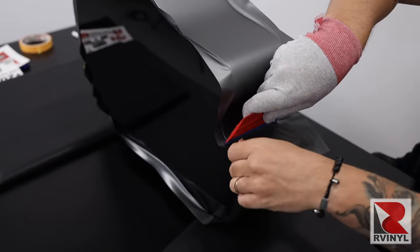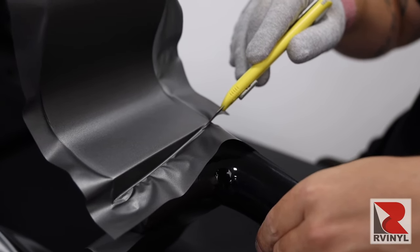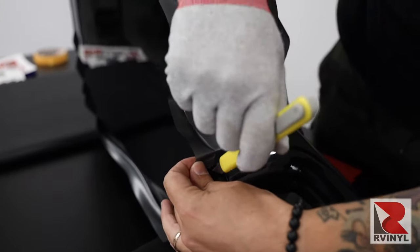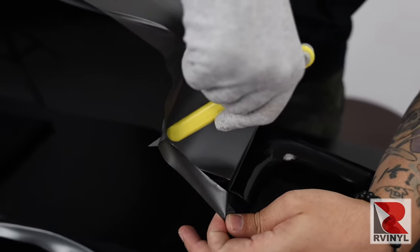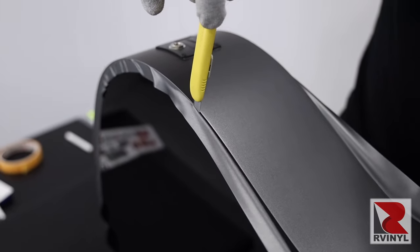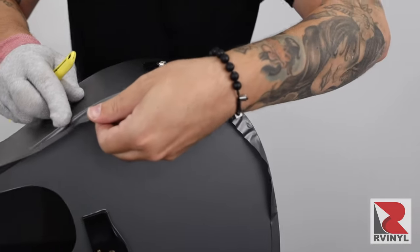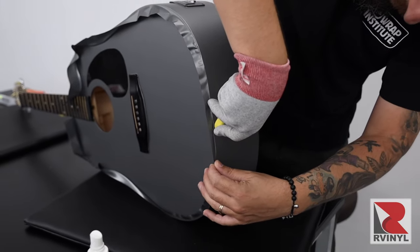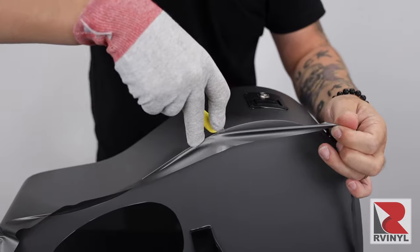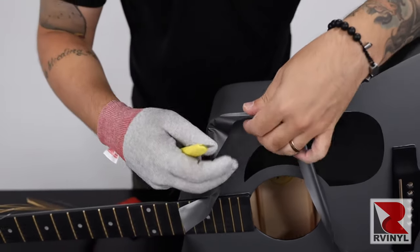The final stage is to read the wrinkles and spread the tension out evenly — pulling low and flat to one corner, then picking the material up and pulling it towards the other corner. Once the material is tucked safely into the base of the neck, cut it away safely with a sharp blade, then come back in with a hard-sided squeegee and seal the deal. To remove the excess film, repeat the same steps as from the main piece applied to the top: the free hand pulls the material safely away to create nice even tension and the blade runs parallel to the bottom edge. Always run a finger to make sure the material is 100% uniform on the edge, then cut it safely away. The overlap in this case will be about a 16th of an inch, because the angle of the blade on both sides was 90 degrees — this creates a perfect uniform overlap that is extremely hard to see yet very durable because there's no tension on the edge.